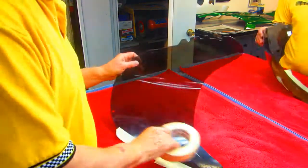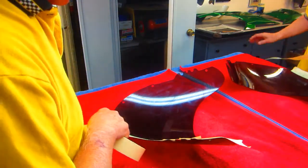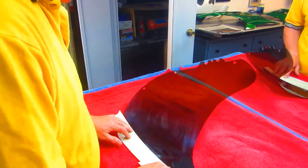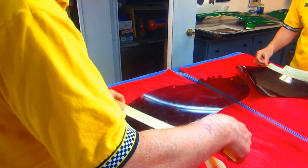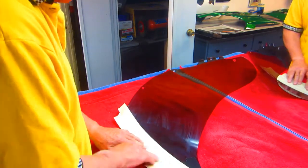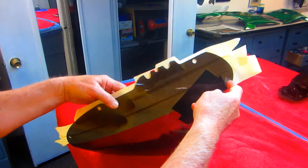The reason for masking tape and not just putting a piece of newspaper there is because when we work on the other side, the resin is going to drip around and get all over this — it's going to make a mess. I've done this enough times to know, whether I'm making a model airplane fuselage or wing, that the side you're not going to be involved with — it's not a great idea to hope nothing gets on there, it's just better to protect yourself. We want this side so that when I pull off the tape, I can have the choice of sanding it, painting it black, putting another coat of carbon on it, or whatever.